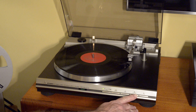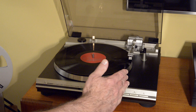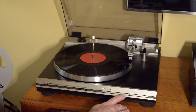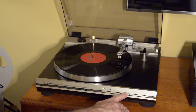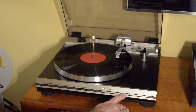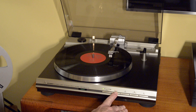At any point you can press the cue, and the carriage mechanism has two speeds. When it comes in to engage the record, that's the high speed; when you're cueing, it's the low speed, so it actually moves quite slowly. One advantage of a linear tracker is that if you're looking to find a track, you can sight directly across the needle and find it. I'm going to try to get near the end of the record and show the repeat function.